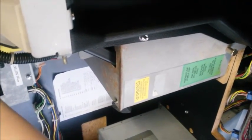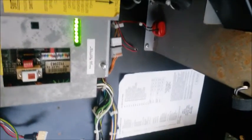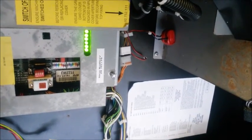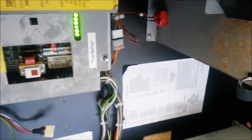So now, open your machine back up again. You can put your cover on at any time you like. I'm just going to put mine on now because I've now finished messing with the MPU. It can be a bit of a fiddle. There we go. Press the reset button. Assume the game will now reboot. Tighten your ground wire back on, that is important as well.